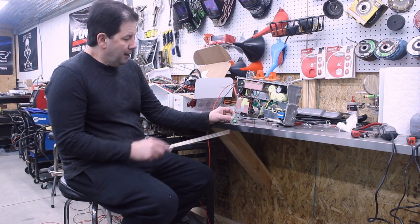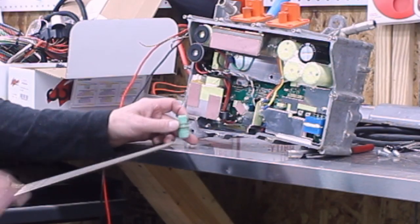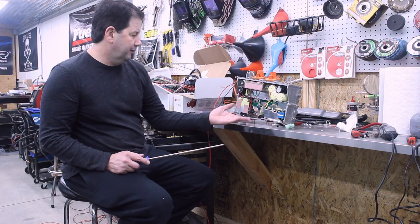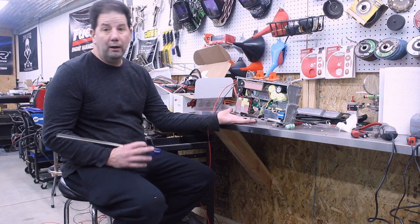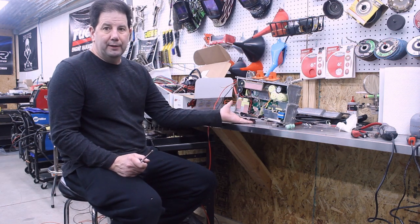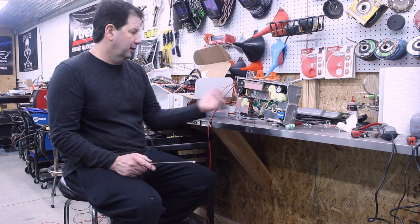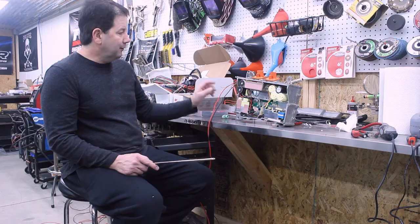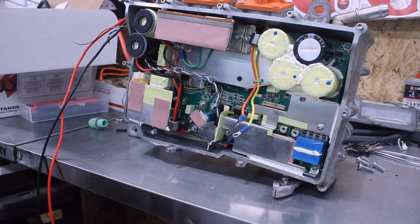So the first thing is the wiring. The input wiring is normally across the bottom. For us, that's not really the greatest option because I was afraid as the car went over something, the car, as I said, only sits 4 inches off the ground. So with the wiring hanging right down there, any branch or something could come up and rip out those wires, and obviously that would be bad. So what I've done is actually tap the case and rewire it.